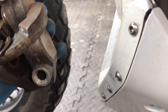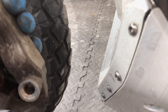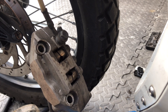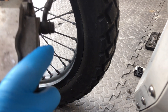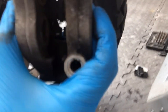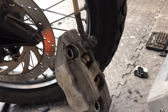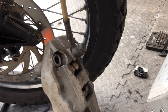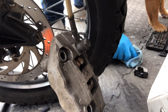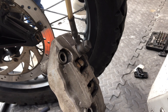What we don't want is for the pistons to come out too far - basically we'd lose all the brake fluid. When dealing with this stuff I need to be really careful of brake fluid. I cracked the top off the reservoir but it's still kind of sealing it. I'll just be able to push this back by hand - right, they're all pushed back now. I just need to quickly check this reservoir - I've got a bit of rag around here to prevent any spillage. You also need to make sure you keep it clean.